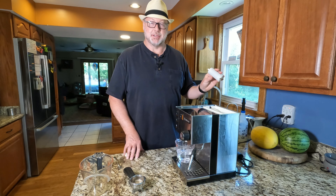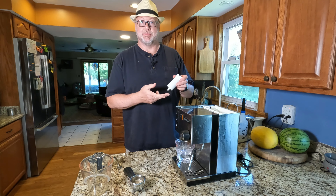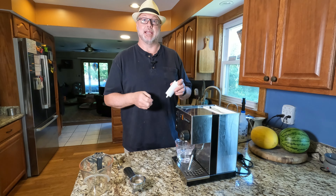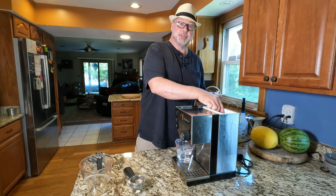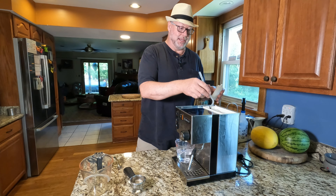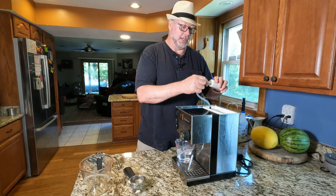It's been five minutes and this is completely flushed. One of the things you want to do is when you're pouring water through it, test the water coming out the top side to make sure it doesn't have any salty taste to it — that's when you know it's completely recharged. Our final step is to hook the water softener back up, and on the Rancilio this connects to the longer of the two hoses going into the reservoir.